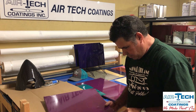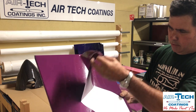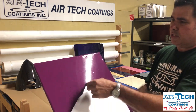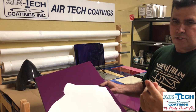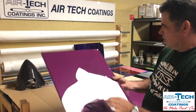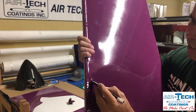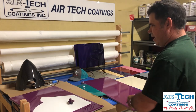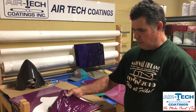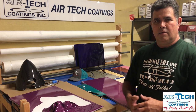This is going to be one demonstration — paint gets started... that's pure paint coming off of the primer. I never sanded that primer, and that is 36-hour-old Air Tech. Now here's the one I did sand — I sat here and scratched at it, dug at it, and tried to get it started — and that's the difference. This is not a happy day when you land and all your buddies are pointing at your wing saying 'what's going on here?' There's a lot of work that went into it for something like that to happen.